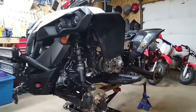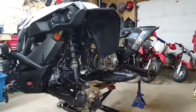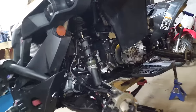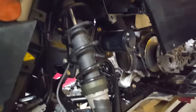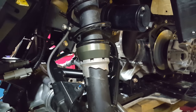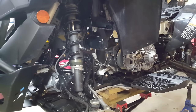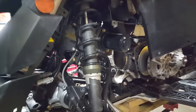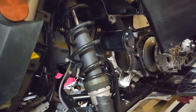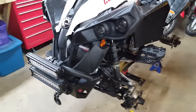So again, I hooked up, like I said, with Sean, Original Mods Design, check him out on Facebook. Again, my setup with the mud, I'm running the low pressure gas shocks. I've got his 1-inch spacer on it here. That's where I'm running with the 30-inch Silverbacks. And like I said, I'll put the Fox shocks back on when I go back to the trail setup. But this really just gives me the ground clearance that I need to run those 30-inch Silverbacks without trimming any fenders or anything like that.